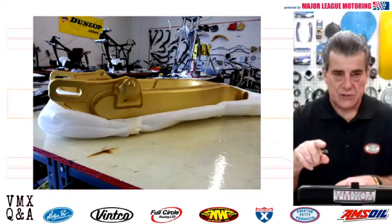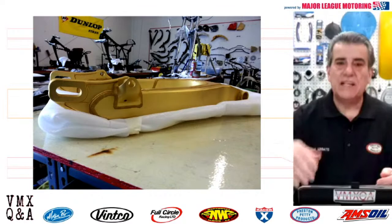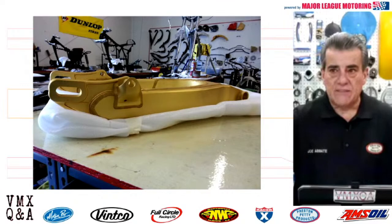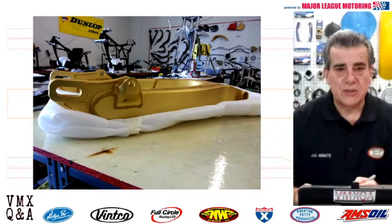Also, something else I want to mention. If there's a color gold that you want to make a little darker or something, when they make a mixture for that color, it's very much like dyeing an Easter egg. How long they leave it in there or how many times they dip it will change the color of that part. It's not just a matter of submerging it into a tank and pulling it out. So keep that in mind, and you can ask your anodizer about that when you go to have those parts redone. When was that mixture made? If it's something that was just made today for that part that you're doing, it could make a little difference with the variation of the color. Phil Job, I hope that answers some of your questions on anodizing.